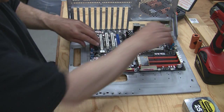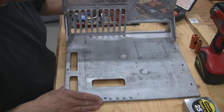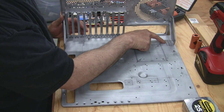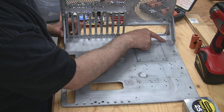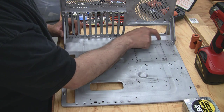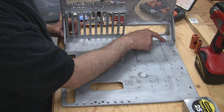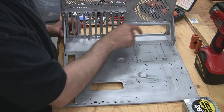So anyway, that's what I've done, and we'll take a look at this a little bit closer. We have this hole here. I went ahead and decided that I'm going to use a three-quarter inch hole saw for this. So I've measured from my center line three-eighths of an inch on either side and drew myself a box, and then I measured in three-eighths of an inch to find the center of my hole saw.